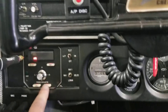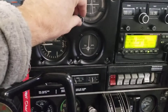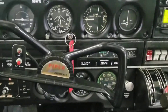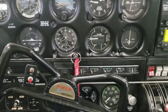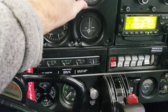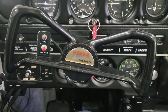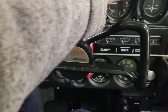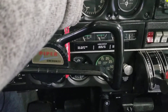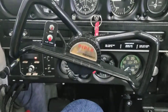If you go to reverse mode, that's for a back course approach. The yoke will turn the opposite direction — the needle goes left and the yoke turns right, so it's a reverse sensing turn. The needle goes off to the right and in reverse mode it turns to the left. I can't say exactly how perfectly it's calibrated until I fly it, but at least it's doing what it's supposed to do directionally in each of the modes.